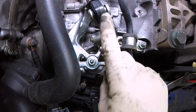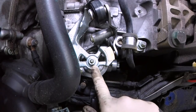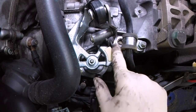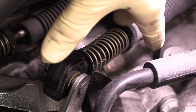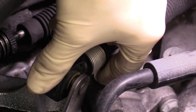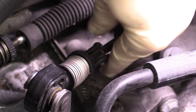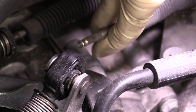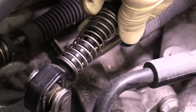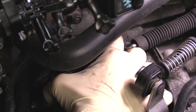This is the piece that we're going to be working with. We're going to take the shifter cable ends off and remove this piece as well as this bracket here. Let's start by releasing the cable ends — that's simply squeezing them together and giving this piece a little turn. Now we can rotate the end off of the cable. Then what I like to do is just twist this back so that it sits in its neutral position. We'll do the same thing for the other side.